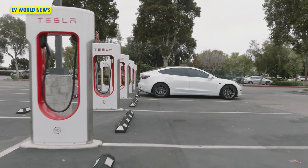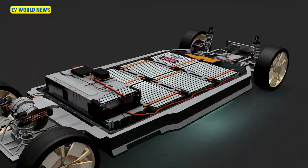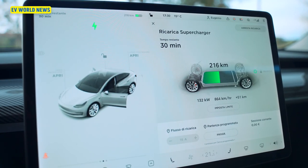Those are big differences, but you're still bypassing a safety feature. It's like taking the governor off your golf cart — it's there for a reason. On the newer version 3 stalls, this trick won't help at all on almost all Tesla EVs except the Cybertruck. The Cybertruck is the company's first passenger vehicle to feature an 800-volt battery setup; the others have a 400-volt. All supercharger stations in the United States aren't capable of dispensing at 800 volts, so the electric pickup splits the battery pack into two 400-volt subunits, making the superchargers ramp up the current to over 700 amps. This can make even the actively cooled V3 handle get hot, which is why the wet towel trick only works for Cybertruck owners at version 3 stalls.